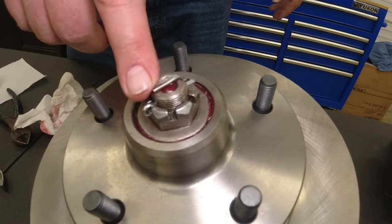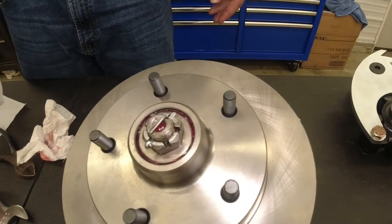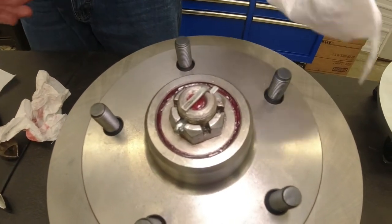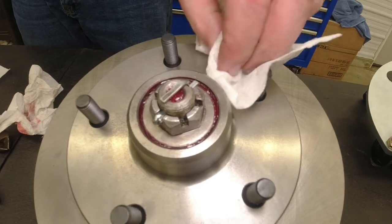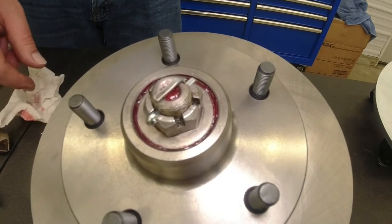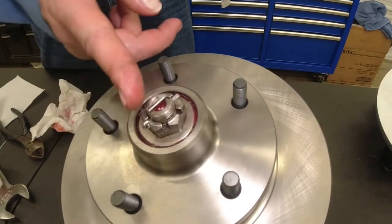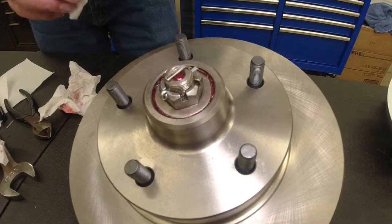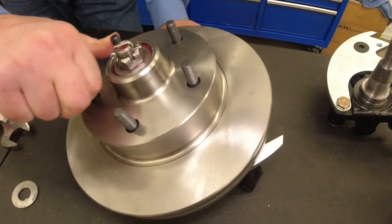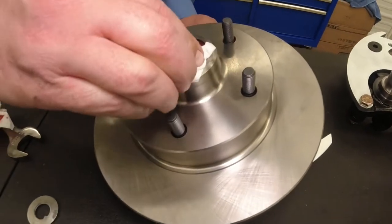That makes it look nice and professional and it's also very easy to service later on — you can easily unbend this, take it back out, and adjust it if you need to. This is recommended after your test drive: put a couple miles on it, then go in and make sure you feel the hub. It's going to be a little warm but shouldn't be boiling hot. You can also put a little bit of water on there — if the water boils, it's probably too hot and you'll need to loosen up your bearing slightly. Usually loosen up one flat at a time or half a flat; with the two holes drilled in there you should be able to loosen up a half a flat at a time. Spin her a little bit to get the grease going in there — it feels really nice. Clean out the excess grease — all ready.